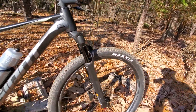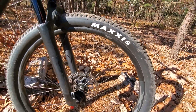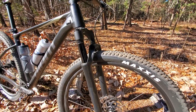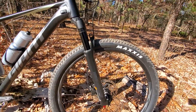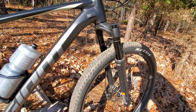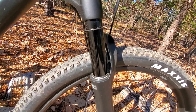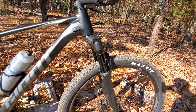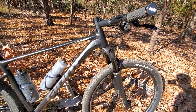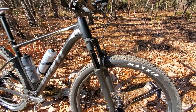Components here — Giant's new fork, the Crest series, the 34. It is bulletproof. I don't think you're going to break this thing anytime soon. It's heavy and it's smooth. My only complaint is I'm at 140 PSI — that's the max you can go. At 100mm of travel I'm about 90% in, so I use at least 90. Where I'm riding today, for those who know, this is Lair State Park in Wall Township, New Jersey. There's no big jumps here unless you're doing the parkway jumps. This was just all drops, XC, roots, and everything, and I'm almost bottoming it out.